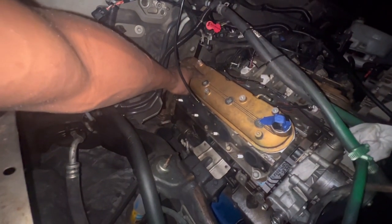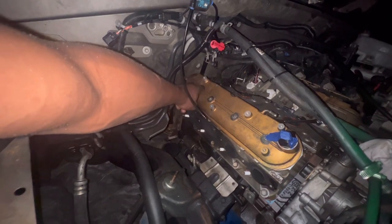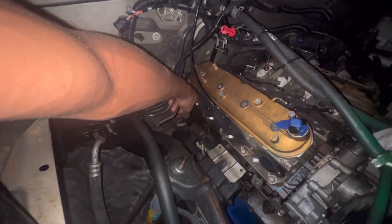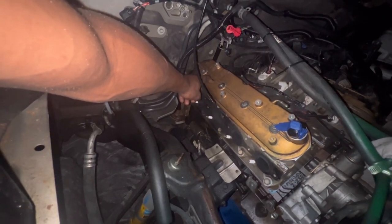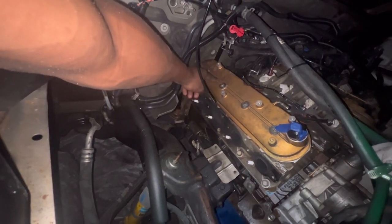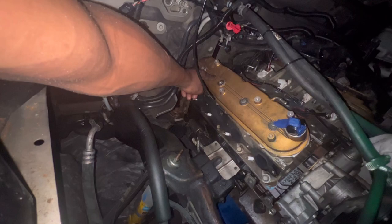Fingers crossed that it's just the head gasket and nothing else too catastrophic. I think the cooling pipe will be a huge contributor, especially adding boost to this motor. The four-cylinder on this side has the issue with cooling in there, so hopefully I can see a crack somewhere — and hopefully not on the piston or side of the block or anything of that nature. We will see.